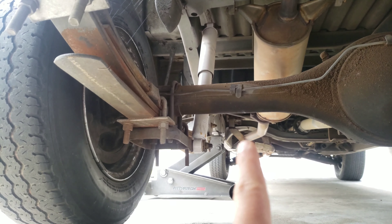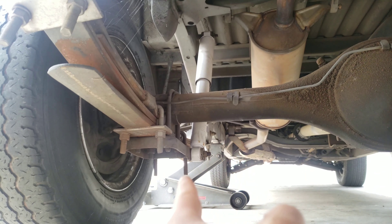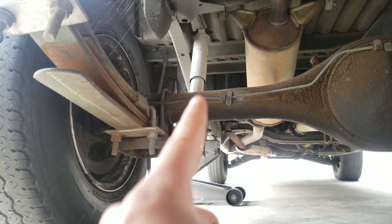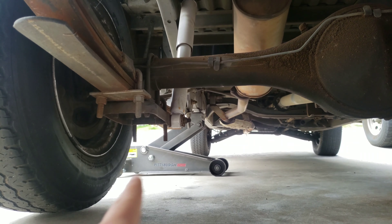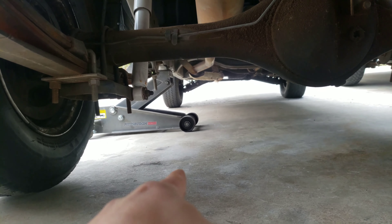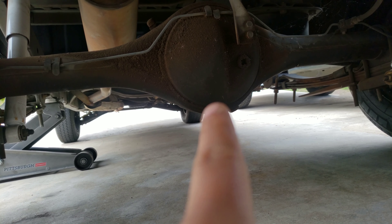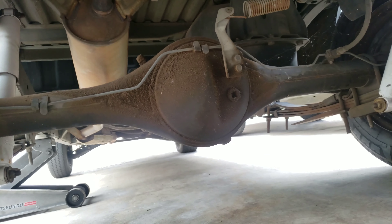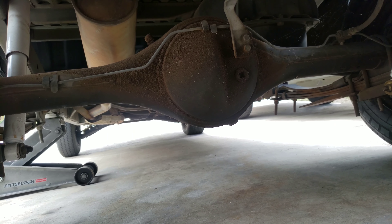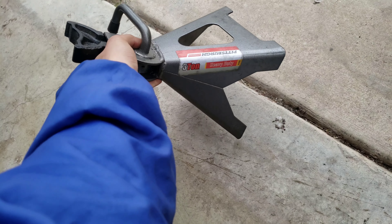That's where you're gonna have to add one of these jack stands to hold that axle, because once you remove that bottom bolt it's gonna come down. Remember, this is holding that to the chassis of the vehicle. Either use a jack stand on that axle, or use that other jack for differentials and transmissions in the bottom there, so the axle doesn't fall on you.